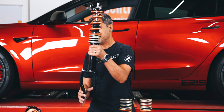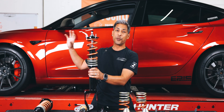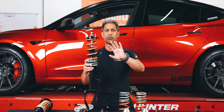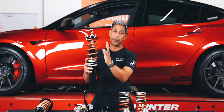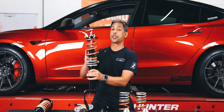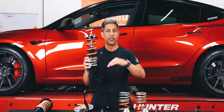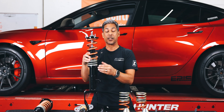Typically what you'd want to do is take this shock assembly — if you have a true coilover where the spring sits on top of the damper itself — remove the spring completely, have the upper mount on, install that shock assembly in there, obviously do not connect your sway bars, and you jack up the vehicle. There are a ton of videos on YouTube from various companies discussing how you should really set up a coilover designed like this with an independent shock body from the bracket. You install this thing without a spring, put it in there, compress the shock with the wheel and tire assembly on there, and check exactly what the clearances are with that tire all around — inside the fender, sway bars, tie rods, all that good stuff. Make sure there are no clearance issues, and if there are, you adjust the shock length itself.